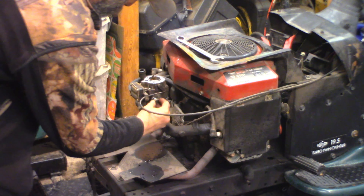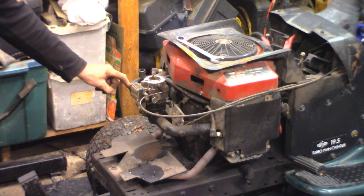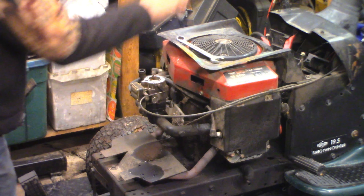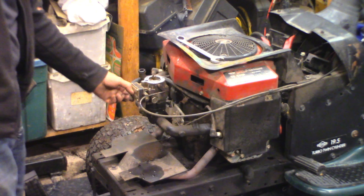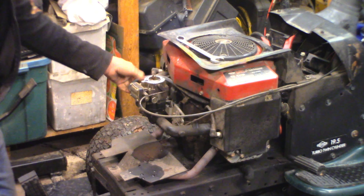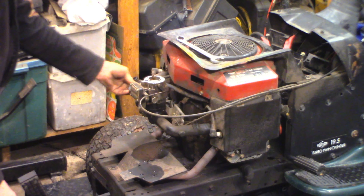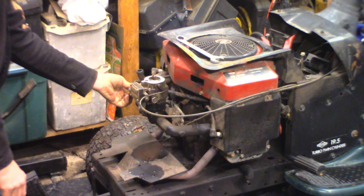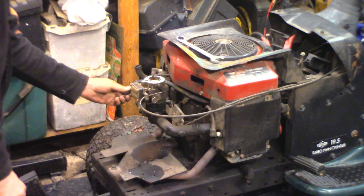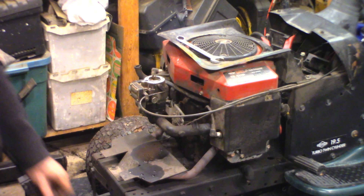What I'll do is take the line off here at the feed and either pull a suction on it to pull it through the whole system, or I'll put a little pressure in the fuel tank and it'll evacuate out this hose. Well, that hose is all cracked anyway — hard as a rock, I can see it all cracked — that needs a new one. Can't leave it like that, that's a fuel leak right on top of the muffler. So we're going to swap that out. But we're going to use the old hose to get the water out of the system first.